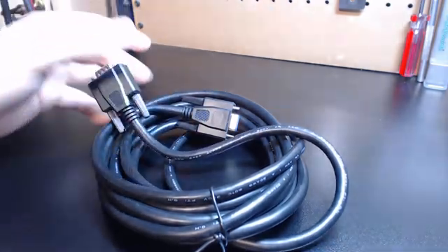Best of all, you've got a lot of different cable versatility options. One of the big things also is lengths — I get asked about cable length all the time. A guy typically doesn't need 20 feet, but doesn't really need 15 either. These cables I made 13 feet just to give you that little bit of an edge. You can connect two of these to actually go longer if you require. If you were going to go much longer than two cables, I would definitely recommend stepping up to the 18 gauge pro solderless cable, because you'll get some voltage drop the longer you go — not a huge amount, but it will become more substantial.